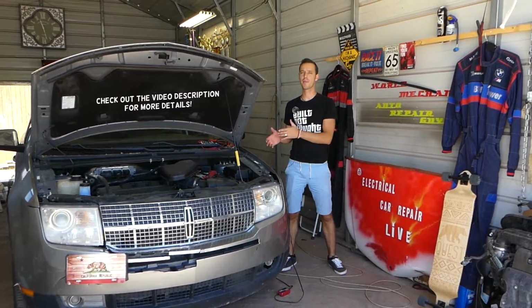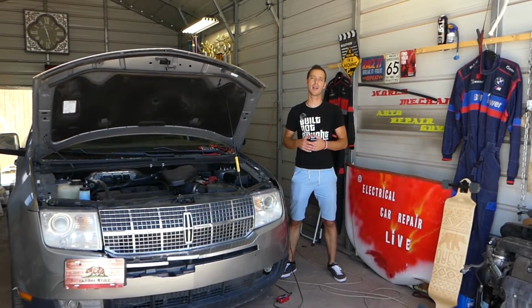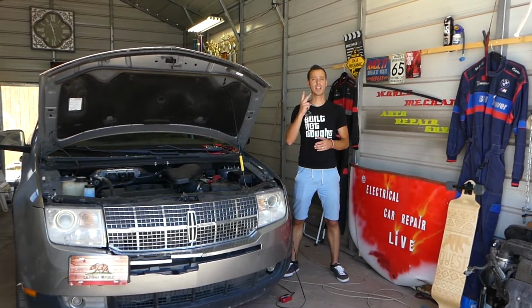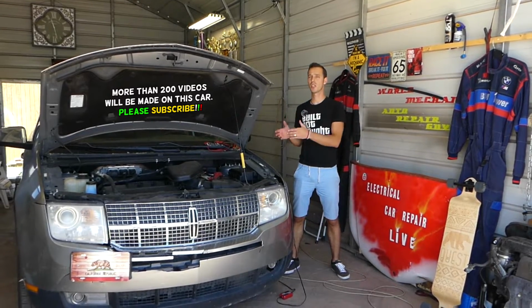If you have a Lincoln MKX that does not start and it sounds like a bad fuel pump, we will show you where to find the relay for the fuel pump. Now, you have a fuse, you have a relay as well, so always make sure you check the fuses. We have a video that explains how to check the fuses as well.